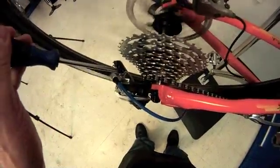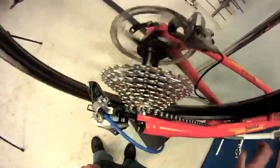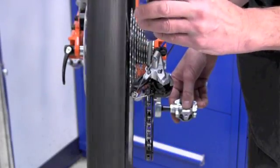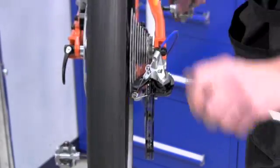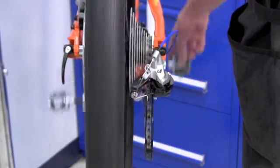Let's put it back underneath again and listen to that nice sound. But what would happen if the H screw were down too far? We get some rattling noise, and the rattling is that the chain is trying to shift to the next cog. We have now gone too far. I back off a little bit — keep loosening — there, that's quiet. I'll take my finger and pull the cable. It drops down quickly. We're going to call that a good setting.